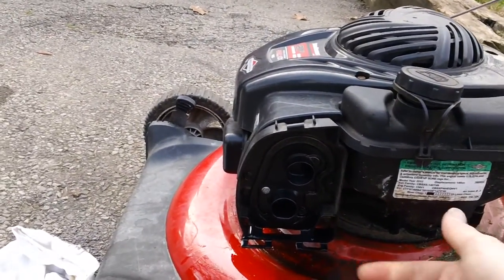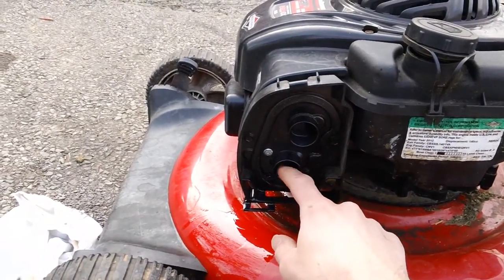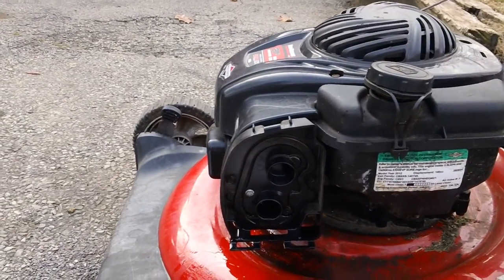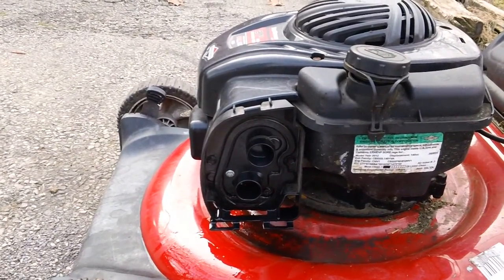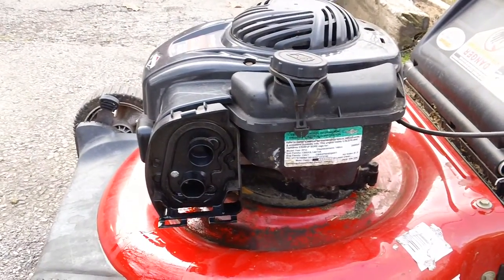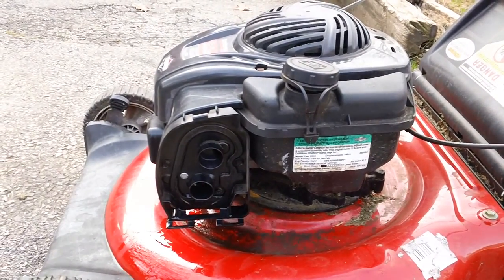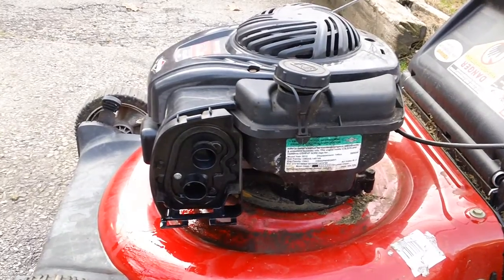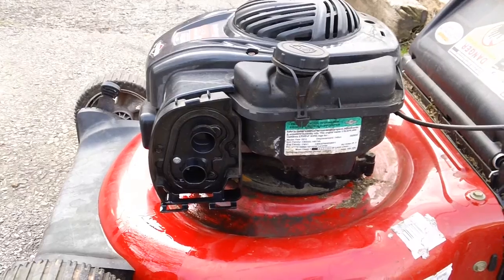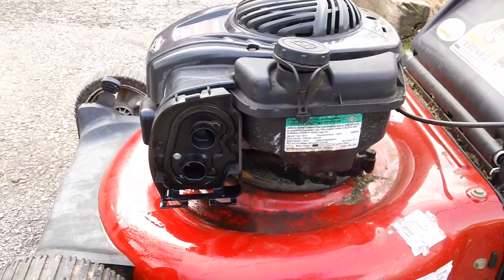And as you see right here, it's dripping gasoline right out of the carburetor's throat. This thing's flooding itself, which means the carburetor is contaminated and damaged internally. With problems like this, let's say you have a 50-50 chance of it being repaired with a carb kit. However, in my personal preference and past experience, carb kits more than likely do not solve this problem.